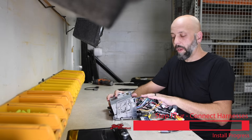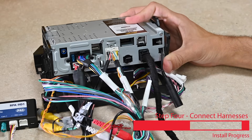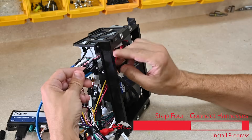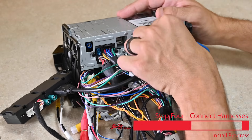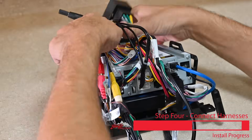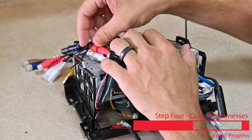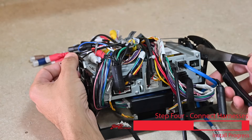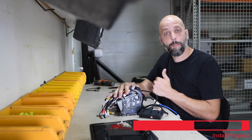Now flip the whole assembly over so that we can install the two LVDS cables and the power and USB. Connect in the LVDS, power, and USB cables, then route them through the kit so they can connect to the display. The last connection to make here is the HDMI cable into the back of the Stinger unit. Because the dash is very tight inside the Jeep, bring the cables up close to the module and zip tie everything so it's nice and compact. Pass a zip tie through one of the side brackets, over the RCAs and other wires, and down through the other bracket. Trim off the excess. Now we've got the wires tightened up on the brain and the display in the kit — we're ready to head back to the Jeep.